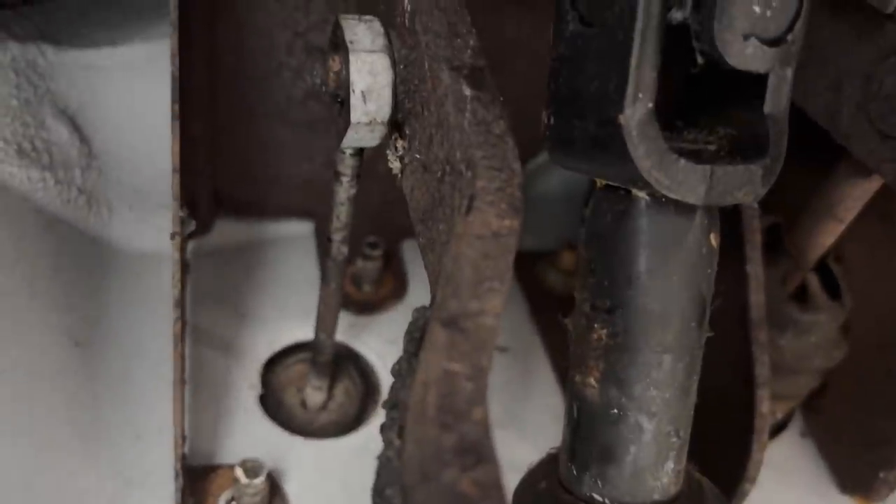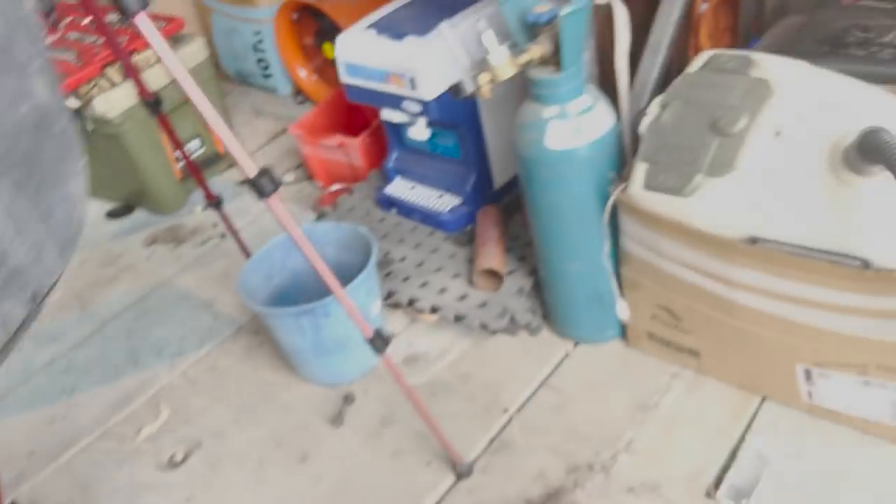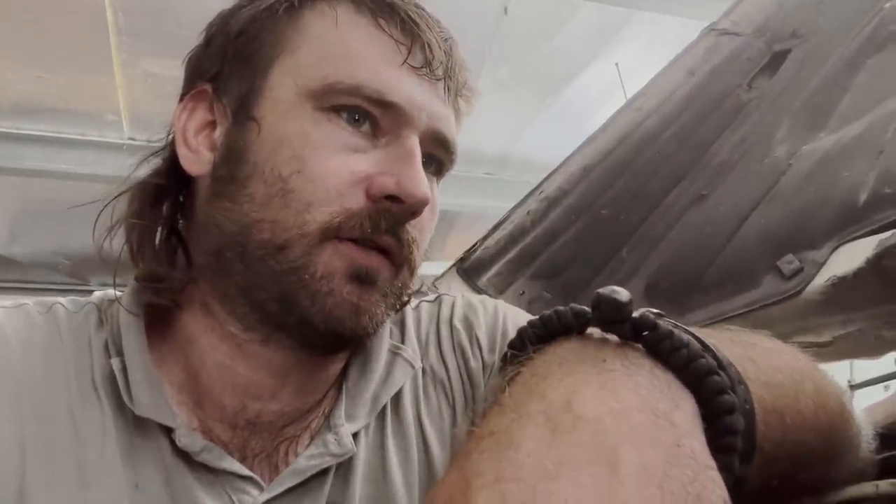See how it goes over that — so that way you can get that clip on there. That's in the hole and that's on there — it's all threaded, bolted, looped. So that way it's not bolted and I can't really push the pedal — it's not connected. But that'll work. I'll bolt that in, get that clip on, and then I'll run the clutch line. Then I'll get down there, put the slave cylinder on, put the starter motor on, put the drive shafts on. And then hopefully we can trick the inhibitor switch — I might call my auto electrician mate and see if he knows which one to join together so it thinks it's in park, and hopefully we can get it fired up. That'll be good. Looking forward to it after all that stuffing around. But we still got no pedal feel — cutting lines down to the clutch and everything else, and bled it.